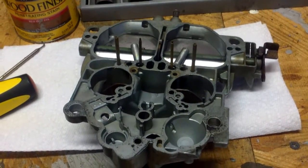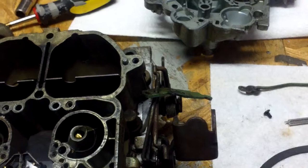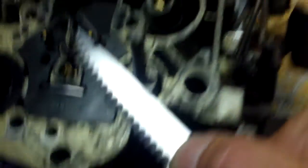Now, if I had a third hand, I could pick up the air horn and turn it over — remember to be careful not to damage those brass emulsion tubes — and gently and carefully position it onto the top of the carburetor. There's a gasket that goes in place here, but I'm not using it for this video just so you can see what I'm doing. What you do is gently, carefully seat that air horn on top of the carburetor while maintaining your tension on this knife to keep that thing from seating. If you do it right, it'll pop into place — you'll feel it just pop into place. There won't be any sense that you have to push down on anything; it should just plop into place. You can see there are some mounting tabs here. The air horn should just fit into place, and then once you've got it positioned, you can just withdraw your knife blade. And now you've got the carburetor reassembled, and you can begin to attach the screws and all of the little peripheral things that go onto the assembly.